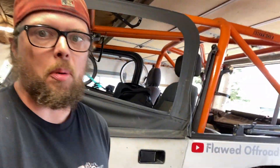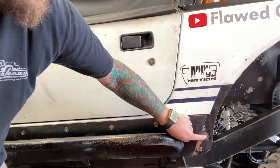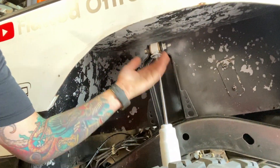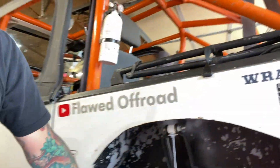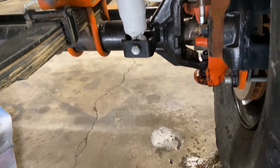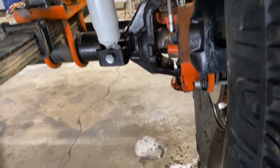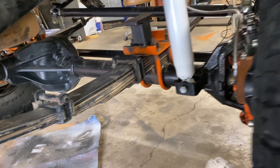Another one of the little things - not too high up on the list, but just cosmetic things. I had repaired this area once before but it's getting a little bit of rust bubbling through. When I ripped the liners out of here, I had painted this like probably seven years ago and it's chipping off. Just little cosmetic things around the Jeep that I want to work on, but it's just not that high up on the priority list. See that gear oil right there? Supposedly this thing had brand new gears and a brand new seal installed when I got it. You can see that's not working out so well. I need to tear this apart and put that little seal in the tube right there, which is quite a bit of work - that's why I'm putting it off and just making sure I'm topped up on oil.